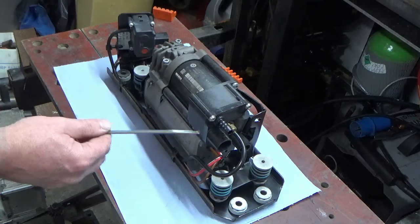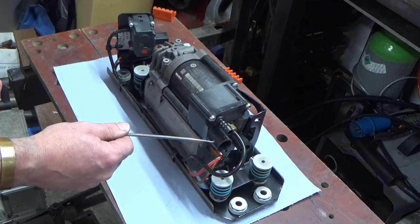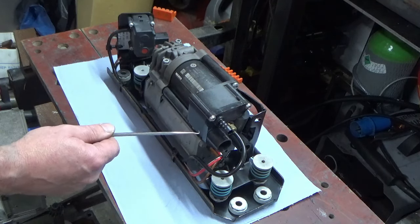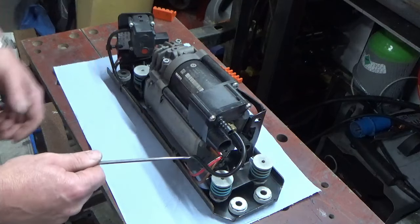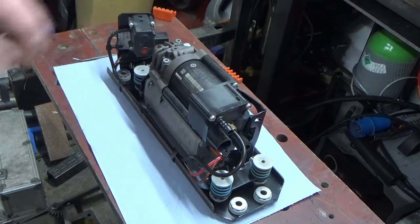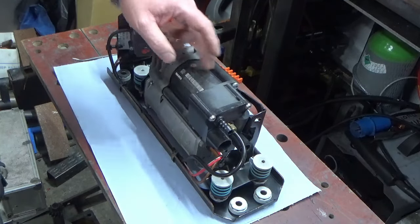I suspect, based on research on YouTube, that it's this solenoid valve here that lets air out of the system which is not working. I think it's staying in a permanently open position, which means pressure never builds up in the cylinder and doesn't get into the airbags - or it has an intermittent fault where the airbags have pressure but then it won't stay closed, opens slightly, and all the air comes back out. So I'm suspecting this solenoid valve - the £25 option. I'm also going to check the desiccant to make sure it's not full of water.